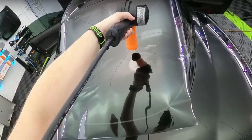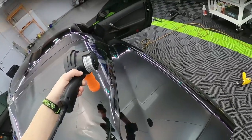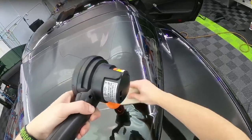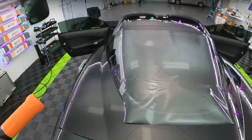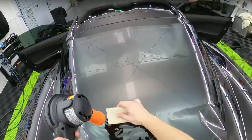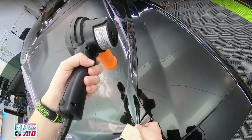So with a dryer sheet, or dry shrink prep, or soap bar, or whatever you use, we're doing a method called dry shrinking. And what that means is that you put a medium material, like something in between there. It helps the film grab onto the glass a little bit, but it also helps it float. Just try without doing anything, and then you'll see. It needs something to give it a little bit of stick when you're shrinking it, but not too much.